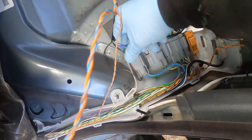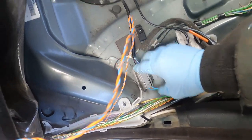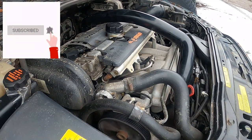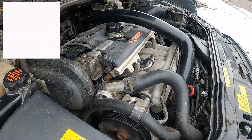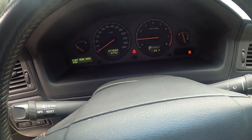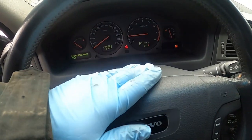I connected everything. Keep the airbags connected — just move the seats away. The pump connector is connected. Let's prime the engine and get fuel to the rail. It should crank a few times and then eventually fire up. There you go — sweet, it's running! It started. And that was a $25 repair, and in 10 minutes I showed you how you can do it with just a test light and a basic multimeter.